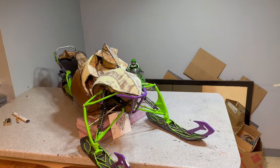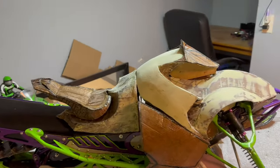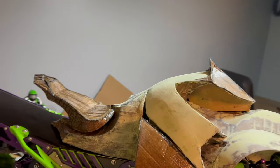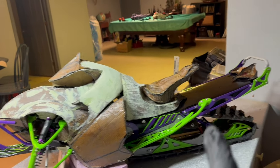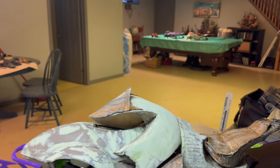Yeah, that's pretty much all I can do with the Bondo right now. I did the body filler right here. Make sure that everything's nice and round, so I'll use less clay. Got all my gaps, you can see all the low spots. And whatever's left on there has to be made with clay. The only way I can do it, because Bondo dries pretty fast and it's not easy to work.